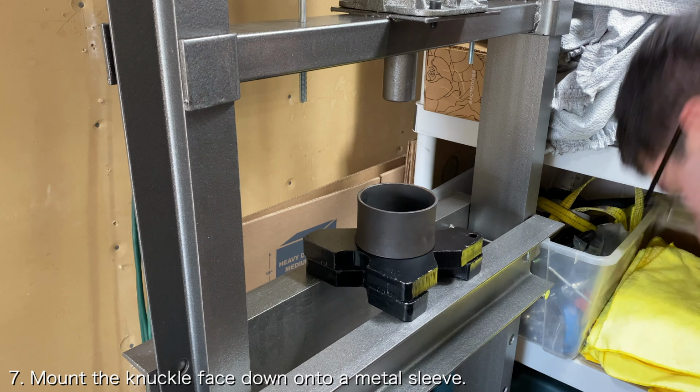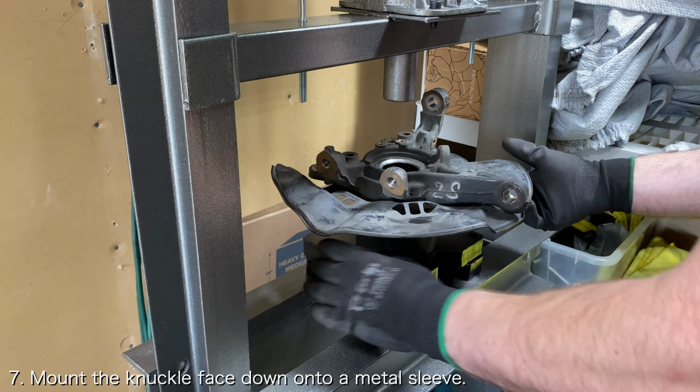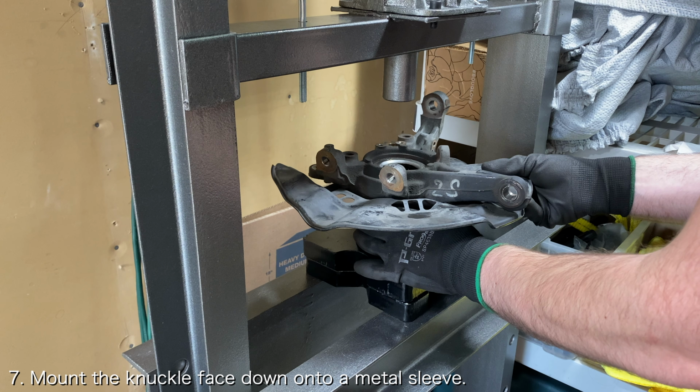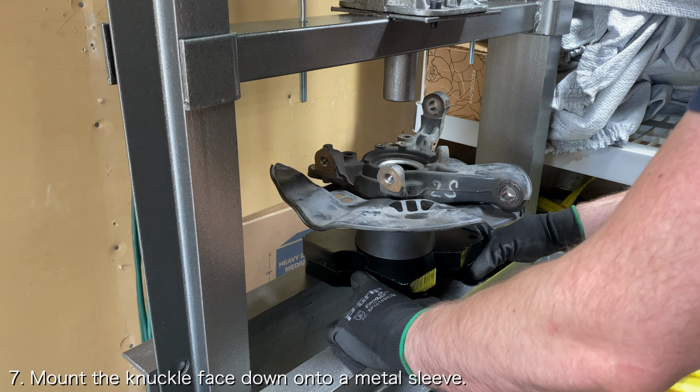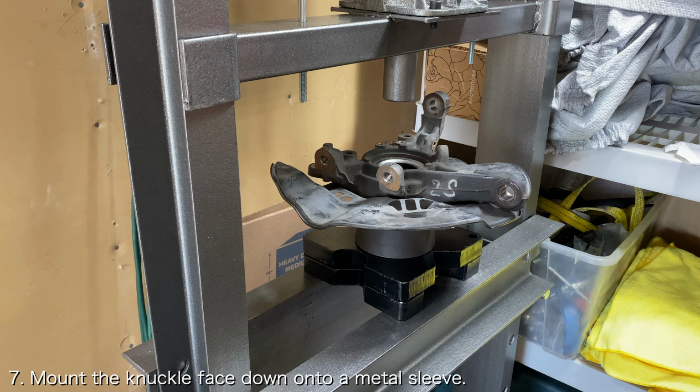Mount the wheel knuckle on the press so that the outside of the wheel knuckle is facing down. Ideally, you'll want to mount the wheel knuckle on a metal sleeve that is wide enough to support the wheel knuckle and also allow the bearing to pass through. I'm using a metal sleeve and adapters that came in a front wheel bearing removal kit that I'll link in the description box down below.